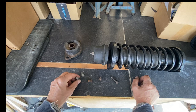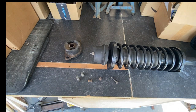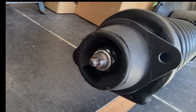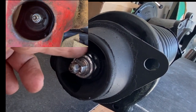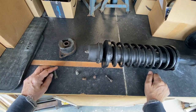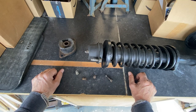The only other alternative would be to compress the spring and fit them separately to the strut. But I don't really want to do that because I've changed the dampers to SPAX dampers, and there's no real way of getting hold of that nut to stop the shaft turning when it's deep down inside the car — I'd have to make up a special tool. When it's on the car I'll keep an eye on it and see if there's any evidence of it touching, but I think that would be very doubtful. If anybody's got any other views, please let me know in the comments.